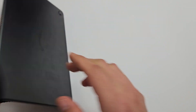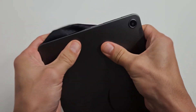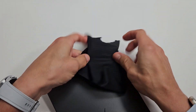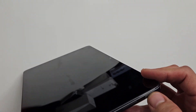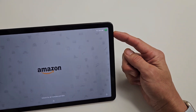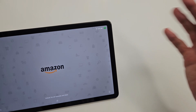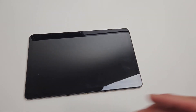Continue pressing all over, and do the same on the back — press around the lens area especially. If you hear a little click on the back, turn it over and tap the power button. After massaging the back, tap the power button and see if your screen is on. If not, press and hold that power button for 16 seconds, let go, wait a few seconds, then press and hold to boot back up. Wait for the Amazon logo, then let go. Hopefully you're now up and running.